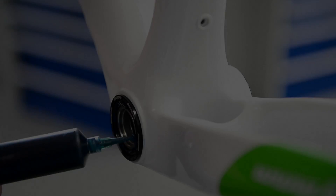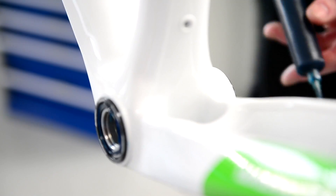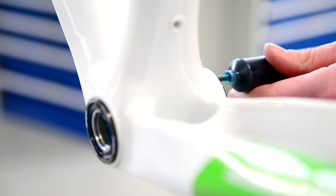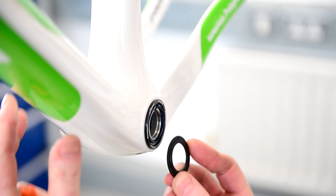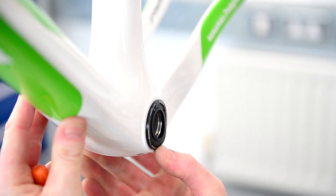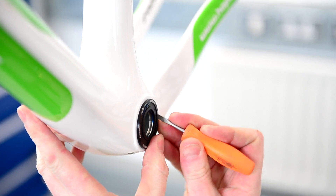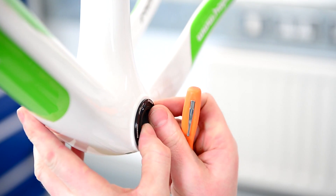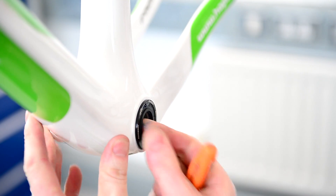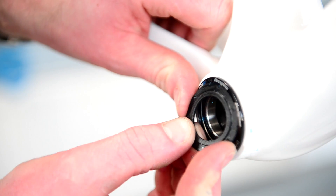Take a little bit of grease. Note that on some later cups the seal isn't in a groove, so if there isn't a groove there, don't worry. But if you do have a groove, you may just have to fold the seal into position and then gently press it into the groove. Just wobble it up and down and make sure everything spins nicely. Do the same on the opposite side — but as mentioned, if there isn't a groove there, don't panic.